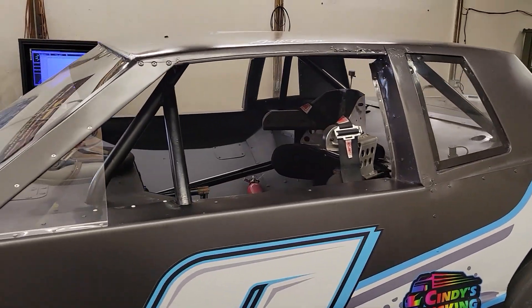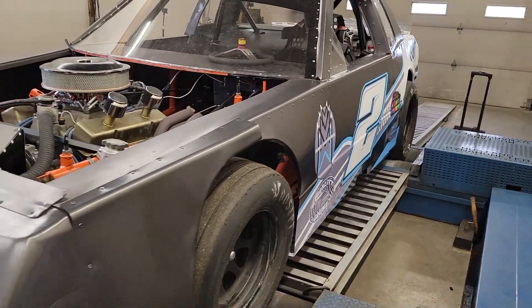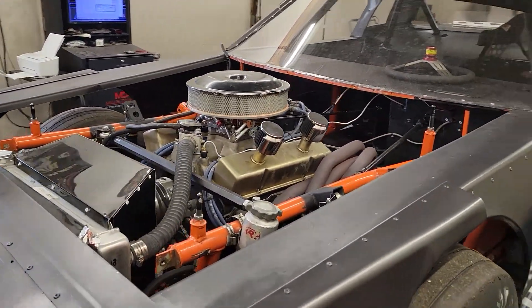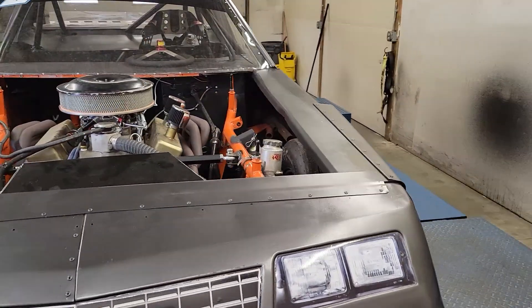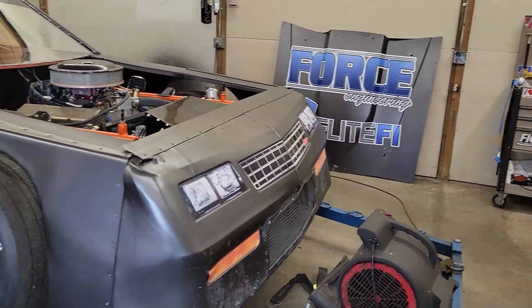We sponsor him some stuff, so excited to get this thing running and see what we can make with it power-wise. These typically make in the high 3, 400 area, depending on how hard we're going to turn it. Like I said, I think we're going to turn this thing around 7,000. It's got a Quick Fuel carburetor on it that's new, so we're going to have to do some jetting work, I'm sure. Usually they're close, but they always require a little bit of love.